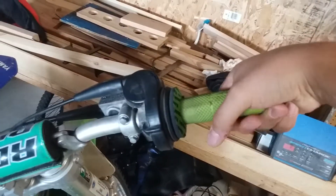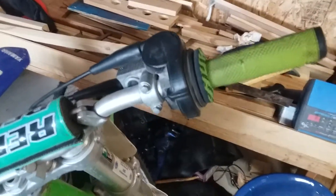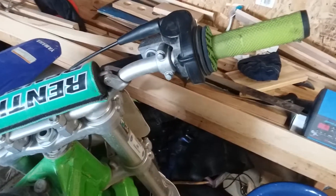If you are doing that - if you have full throttle and let off - every couple of seconds just give the throttle a blip. That'll give your engine just enough oil to not seize. Or you could just hit the brakes, which slows the engine RPM down quite a bit.